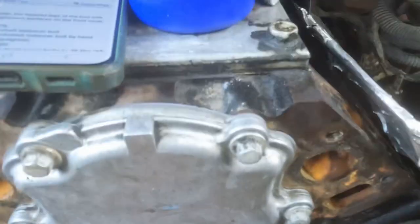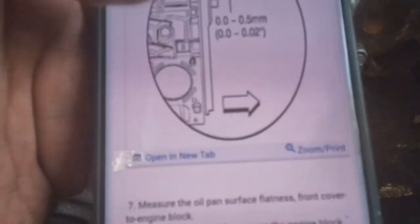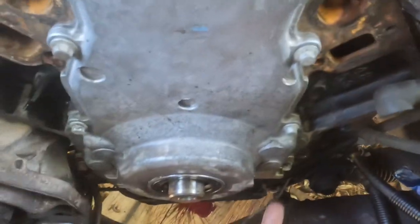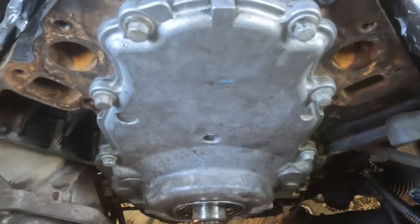I did install it right now and there was a big gap right here, so loosen them up if that happens, then pick up the whole thing, hold it up, and tighten one bolt down, and that's far enough. Just make sure it's pretty much flat right here on both sides, and then torque them down to 18 foot-pounds. Same as any other one that I've been showing y'all. It shows no torque sequence, just 18 foot-pounds. Just like always, go across. Important thing: make sure it's flat on both sides, 18 foot-pounds, and cross pattern, and just keep going.